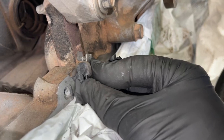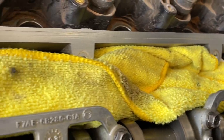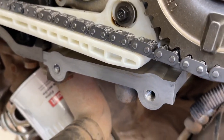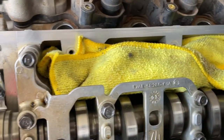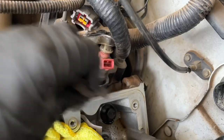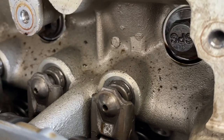I've wrapped a plastic bag inside the timing chain and made sure it's not going to go down into the exposed oil pan. In some places I even took a flat razor blade and cut the silicone off from the previous installation of the timing cover. You don't want to dig down into it, but you do want it flat. I put a microfiber towel down into the heads, and as we're scraping and cleaning, you can see we're getting this mating surface nice and smooth — just going along the whole thing. We're also going to do this over where the cam covers will bolt again, just using the scotch pad going all the way around. And especially in the back where you can't see it — that's where it's going to leak and go on the exhaust manifold and actually burn. You can see all this grime down in here.